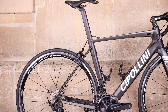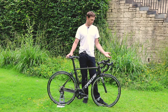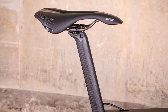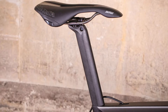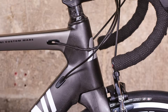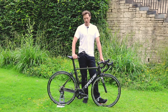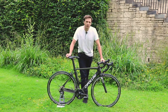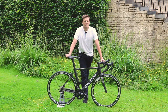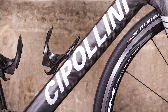This is a stock medium-large frame built to race geometry. It has a 470mm seat tube, a 548mm top tube, and the head tube is quite short at 143mm. The seat angle is quite steep at 73.8 degrees, while the chain stays are short at 405mm. The upshot of all that is that you can see from the start this is a bike built with racing — or at least performance — in mind.